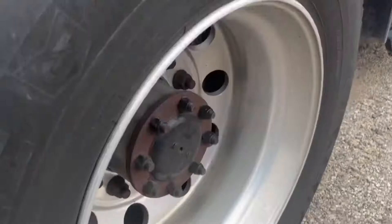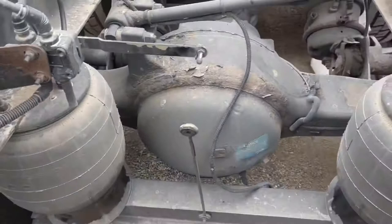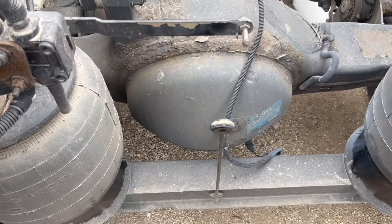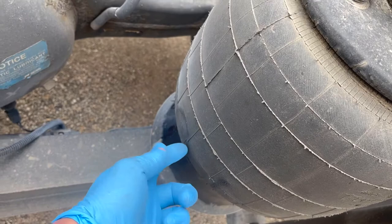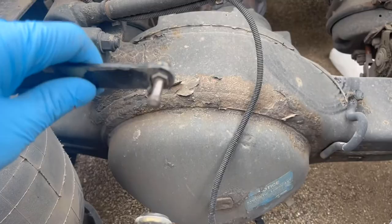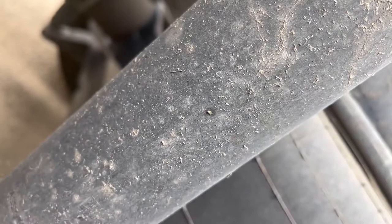Just got to my yard today, I'm going to replace an airbag. This front airbag is leaking. For that purpose, I disconnected the airbag level and picked up the airbag a little bit, because when it's down, the hole is inside the layer and it's not leaking. So just to find out where it's leaking exactly, I had to pick up the airbag to let the hole be discovered. I have a little leak.